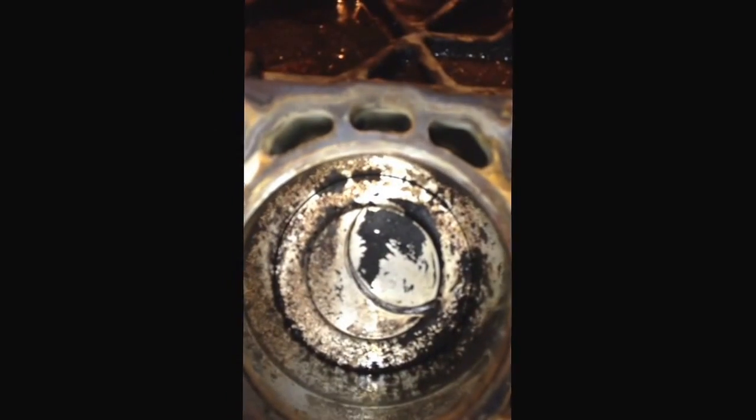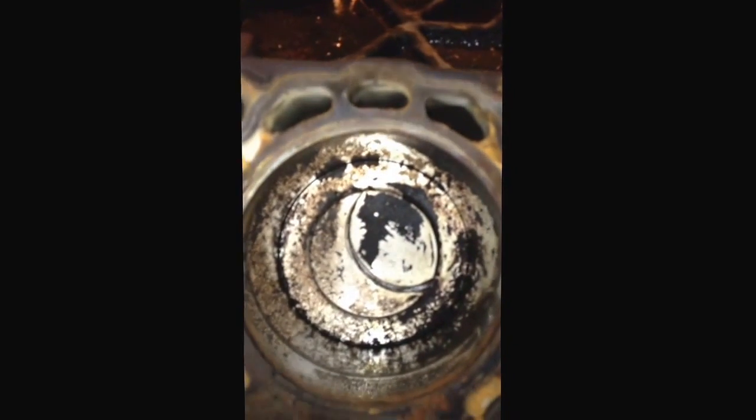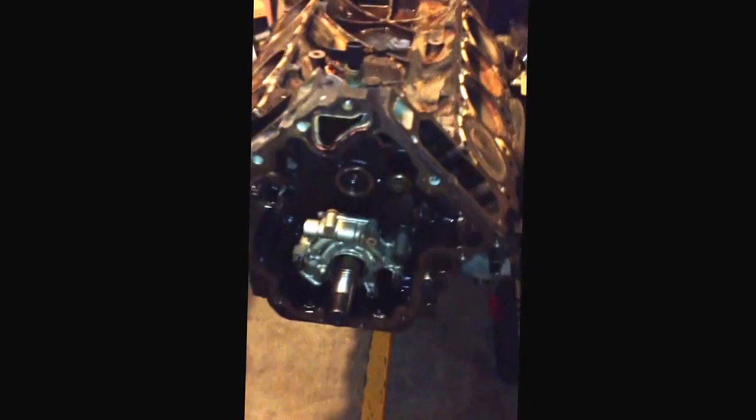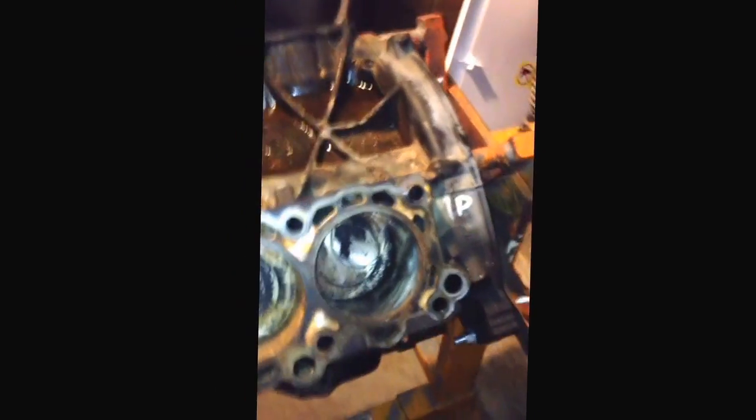Technically, if you replace the head and put it back together, it might run for a while. But I'm afraid that with that damage to the piston, that piston's going to come apart. And when it does, it's just going to destroy the bore, destroy the block, and there's going to be metal pieces going everywhere in this motor. So what's the plan? The plan is we are going to take this motor and break it down completely. I was hoping initially that if it hadn't impacted the head I could just rebuild the heads, but once I saw this damaged piston, I knew we were done for.